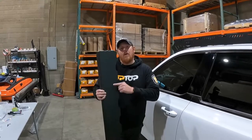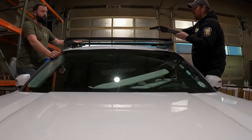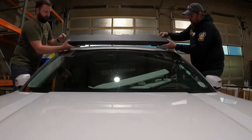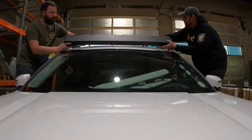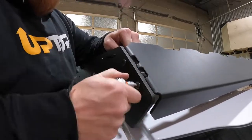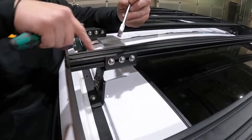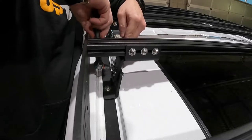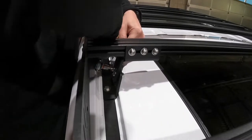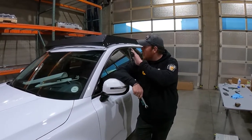Now we're ready to install the windscreen. The cut for the windscreen will vary based on your order — this one's a no-cut windscreen so there aren't any additional holes or hardware. Grab the hardware bag that says 'windscreen' and get your buddy to help you put the fairing into the truck. Align the holes in the end of the windscreen to the holes in the front of the roof rack, slide the hardware in, and apply the nylocks to the back of the hardware. Then use a 5mm Allen and a 13mm wrench to tighten up the hardware of the load bar clamp to the spine. Refer to the chart at the end of this video for torque specifications. Work your way around the rack, make sure all the hardware is torqued to spec, and then reinstall the headliner in reverse order from disassembly.